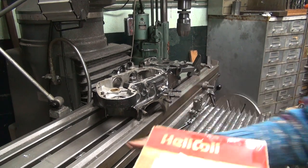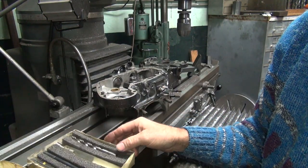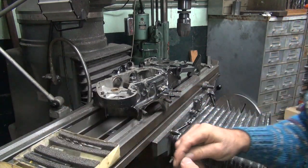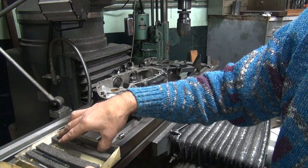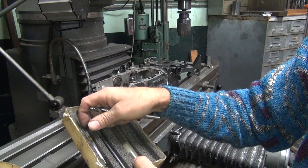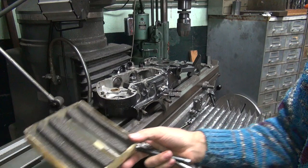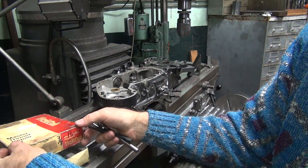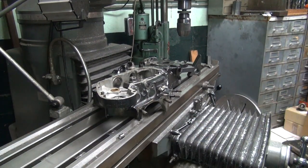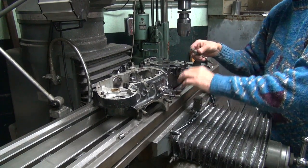Okay, I'm going to put a 3/8-16 Heli-Coil kit in it. Heli-Coil, I should say. I stole one of these in there. This kit's already got the tap drill here, the tap, and the insert tool right here. Get all those out. This kit's pretty old, as you can tell by the box. Delicate with it. Just because something's old doesn't make it bad.